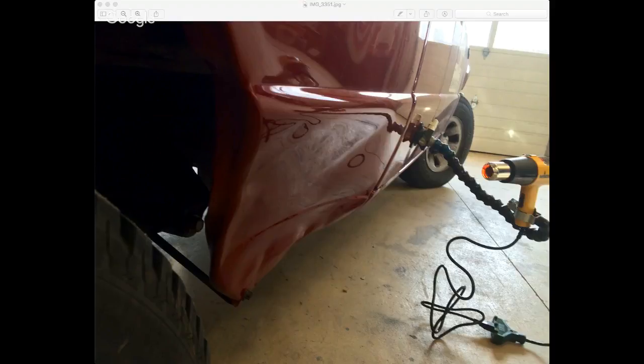Okay. There's actually more to that dent if it goes up beyond that hump. But a lot of that walked after I got the bottom. The biggest problem with that dent was the lower section. So where that stone guard is, that should have been underneath. Oh, wow. So you had to bring this up, and then that's supposed to kind of roll over like this. Oh, wow.